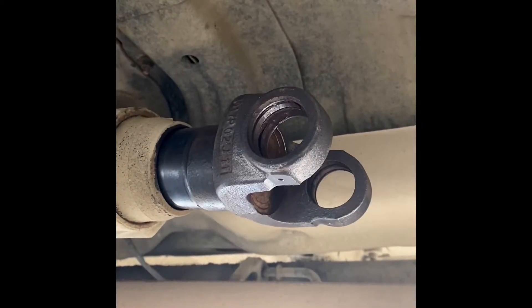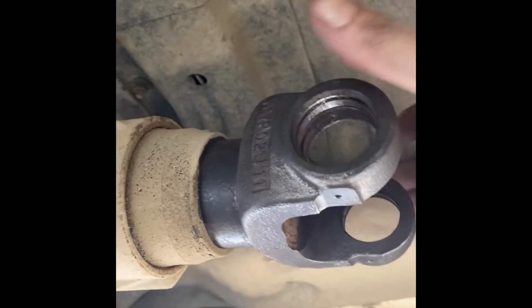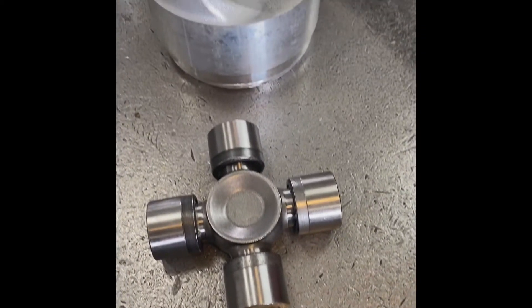All the way back down to the back, still running factory u-joints. So measuring the drive shaft — you want to push this transmission yoke in until it bottoms out, pull it back one inch, about there. Then we're going to take our measurement from center of u-joint cap to center of cap at the back. 1480 series aluminum weld yokes for five inch tubing.